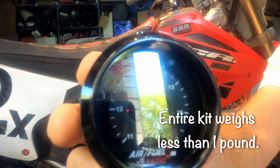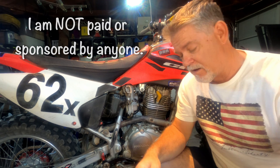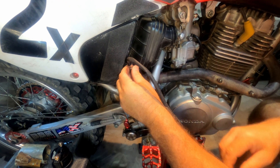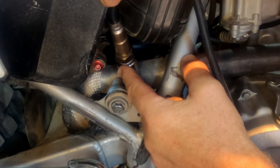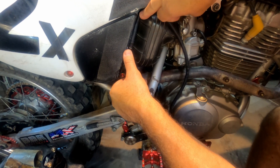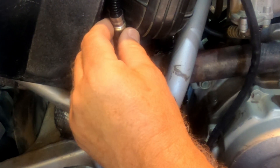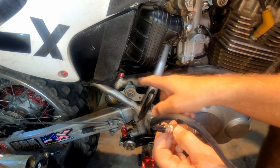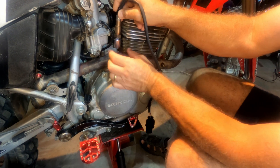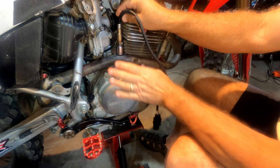That's the gauge, and this is from Glowshift. No, they're not sponsoring me — I get no sponsorship from anybody. There are really only two different places this thing can go. I thought maybe right here was a viable spot, so I could have the wire feed up through here and really get it tucked out of the way. But there's too much heat going to that boot, and there's too much going on down there with the mount. So this is really the only viable place, right here in between. I know it's close to the cylinder and we don't want a lot of heat, but it keeps it out of the way so you're not hitting it with your leg.